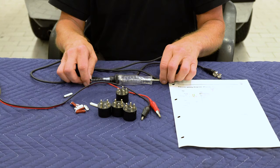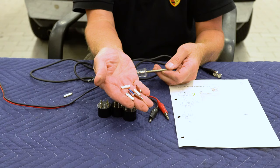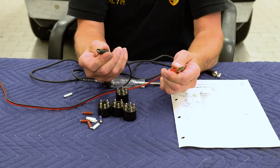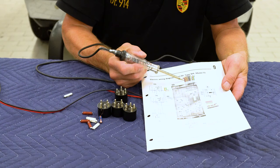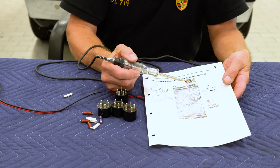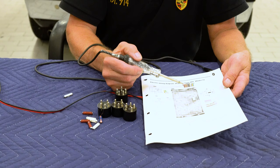Finally, I want to show you a few handy things to keep around in case you run into a non-running fuel pump or a car dying on the side of the interstate. Very important to have a 12-volt test light that you know works — we don't need a voltmeter, that's over-analyzing it; a simple test light does the trick. Then extra fuses: 25, 16, and 8 amp. A wire with alligator clips on either side — for example, if you're going to ground the head temperature sensor, very easy to eliminate that from the circuit with a nice alligator clip wire, about two feet. And then the relay board diagram for those who really want to study the different wire colors — they're always the same in all the Porsches — and where they plug in and how they go. This is readily available online or in the original factory manual in color.